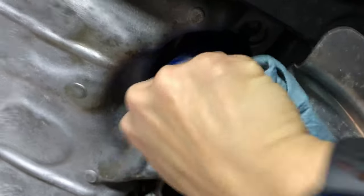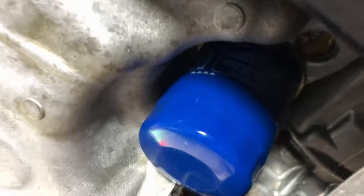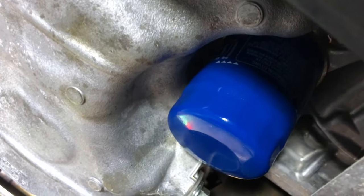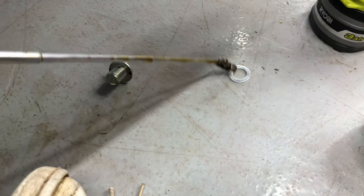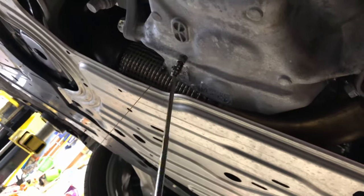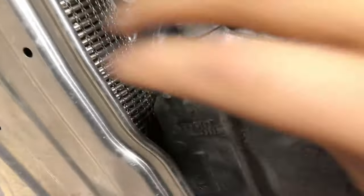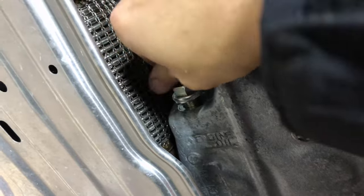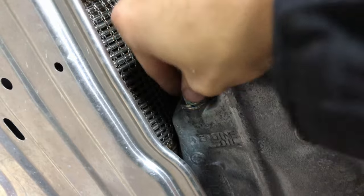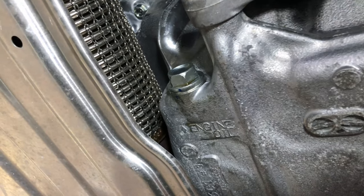I'm going to install the filter hand tight for easy removal. I've done this on almost every car and never had any issues doing that, but the official torque spec is around 15 foot-pounds. Take note that the drain bolt itself is steel, but the crush washer is not. Be careful threading the steel bolt into the aluminum oil pan — they have been known to strip on the aluminum side. You want to thread in the bolt pretty much all the way in by hand; it should go in easy. If not, stop and check your work. It is very easy to strip those threads, and once you strip it, you're going to have a really bad day.